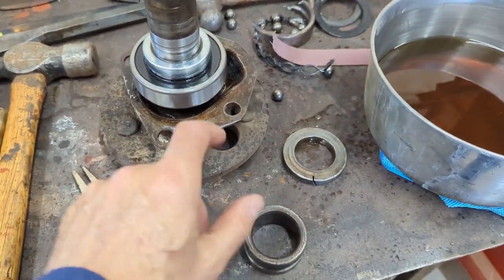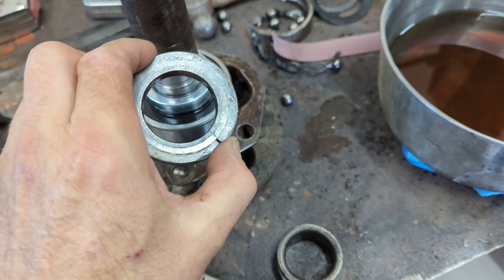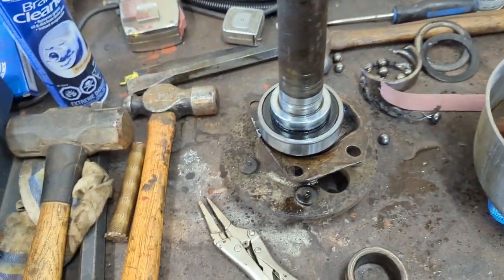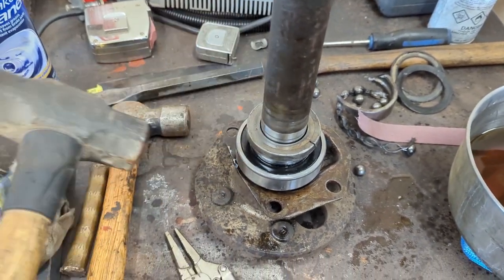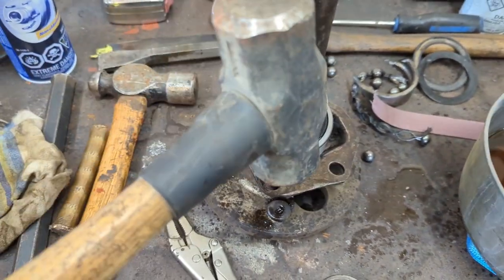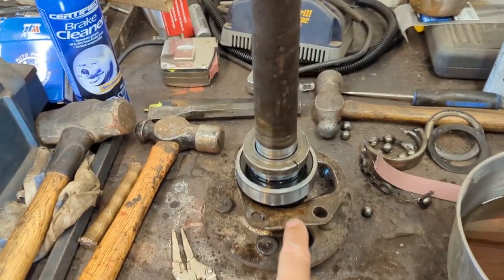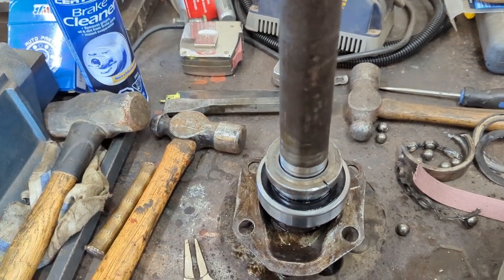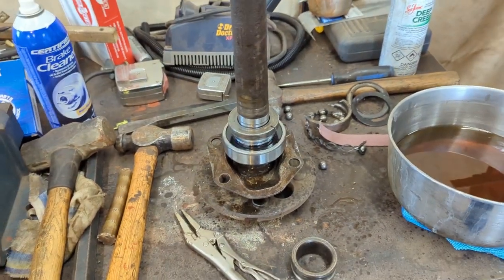For the collar, I had it in the oil as well, put it on, then used the old retaining collar to pound on. Since I don't have a tube to go down over everything, I just used a sledge holding it down on one side and hit it with the ball peen hammer on the other side, shifting around, and it slipped in there pretty good. I'll get this back in the car. Don't forget to put this piece back on before you do it - that's the orientation of it. If you don't, you'll be cutting that bearing back off. Always put that on as soon as possible before you do any other work.